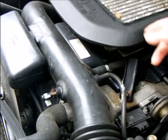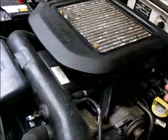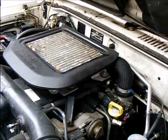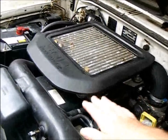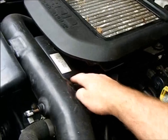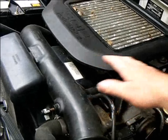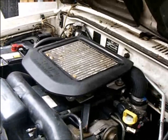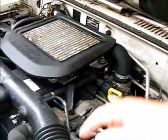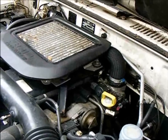But additionally, this one is in another part of the injector body, it's also leaking diesel fuel, and it's getting into the engine oil, you know. Now this is a classic 4JX1 turbo diesel problem, and I can actually fix it by just taking the turbocharger intercooler off, which is quite easy, there's only rubber hoses and four bolts, and I can take the rocker cover off. I can get to the head and use a special tool to get those injectors out, which I'd have to make, but you can make one out of a 16 millimeter Dyna bolt with an extension rod welded to it to make a puller, or you can get hold of the proper Isuzu tool, and that's fantastic.